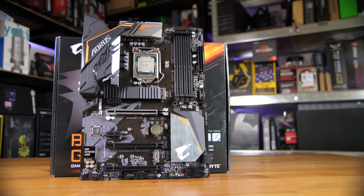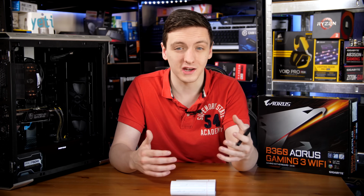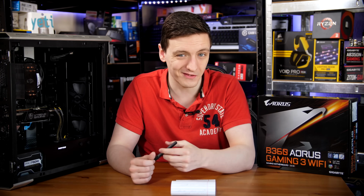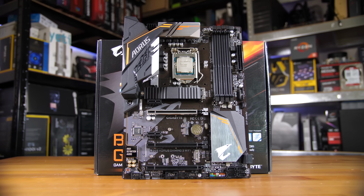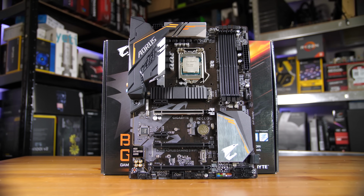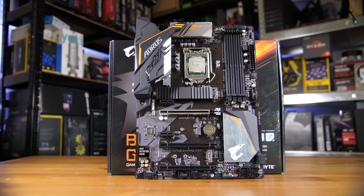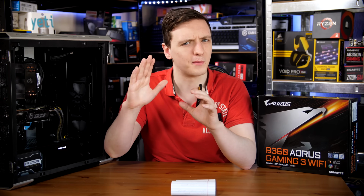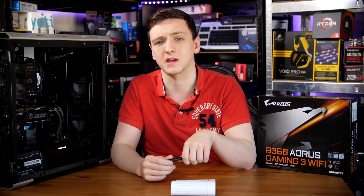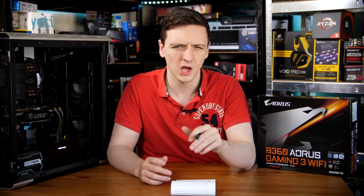Now this is definitely a budget offering for the Intel lineup, especially the 8th generation Coffee Lake CPUs, as those are the only ones that are supported on this chipset specifically. The board itself is a slim form factor, still ATX, but it uses a couple of M-ATX mounting points in the center, and otherwise is a little bit loose on the top and the bottom side, as there aren't any mounting points for those, so just bear that in mind.